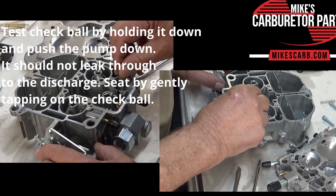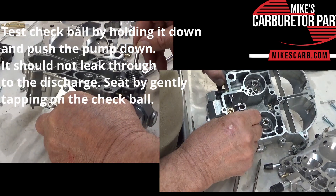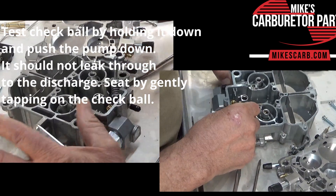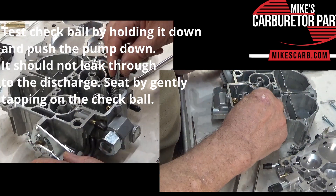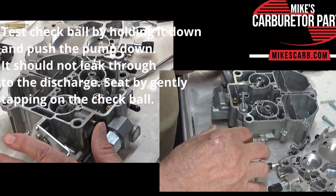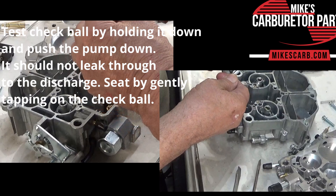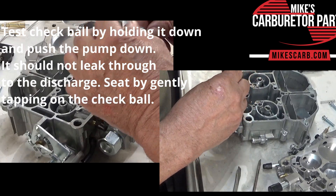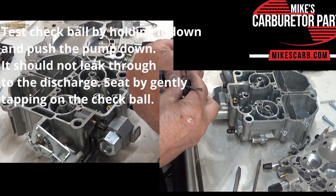Test it — can you see the gas coming out of that hole there? So from here over there it's real clear. I had gas coming out over here, so you know that's clear. So it's probably clear. Check your pump, make sure it's not swelled up. This one will swell with gas after a while because it's not ethanol ready.